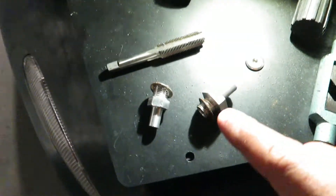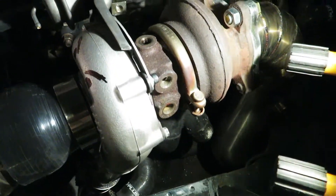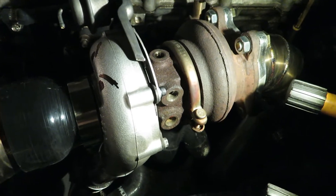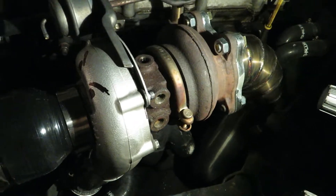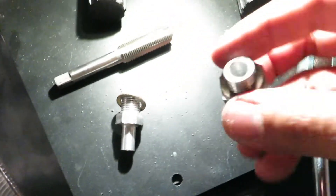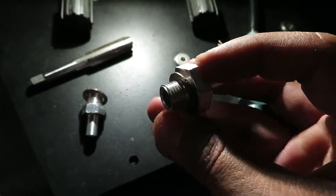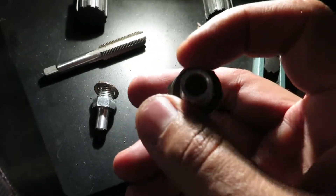Another thing I've done since the last video is create my own water fittings for the turbo. The reason I had to do that is because this turbo — which is a VF30 — uses M12 by 1.25 on those two fittings on the side there, and I wanted it to go to an 8mm internal diameter hose so I can tee it up with the rest of the water system. Looking online out here in New Zealand, there wasn't much choice — in fact there was no choice — so I made them myself, tapped it, did a little hex thing, and yeah, 8mm with a copper washer.